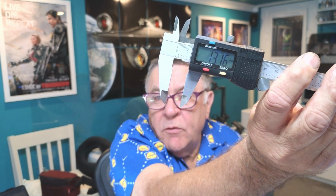There's hardly any wear on the old ones here. Look how much is left. So the new ones are, as you can see, 13.16 millimeters thick, and the old ones are 11.96. So there's only a couple of millimeters worn off them in all them years. And the brakes are set up properly. The balance thing is the right way. It passes all its MOTs, and when the brakes are tested, you just cannot turn them at all. But yeah, it's amazing how it goes through the back ones more than the front.